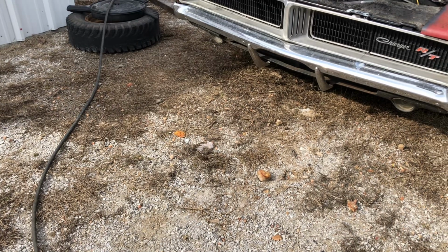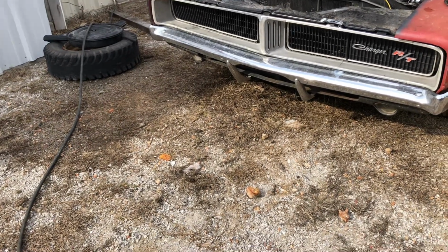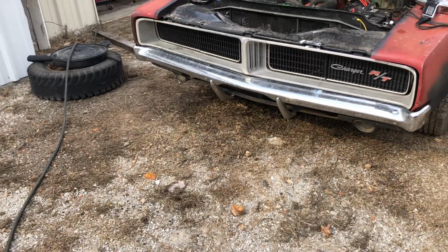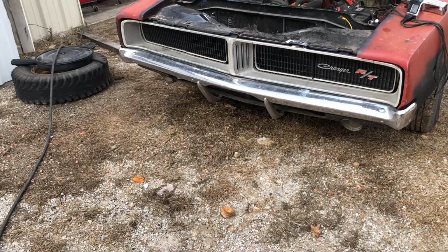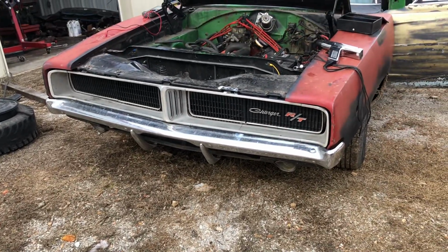But I did notice the resistor. One of the problems could be the alternator overcharging, which it did have 15 volts. Possibility, because it usually sits around 14 or more. But it could have been at 15 because I just started it a couple times. It hasn't quite charged up yet. That could have been it.